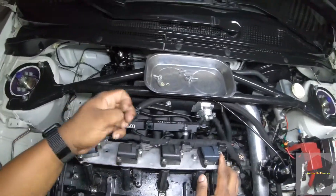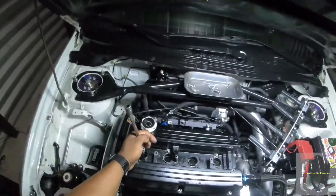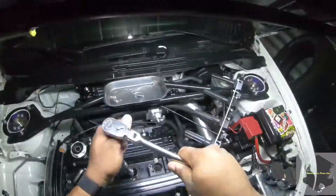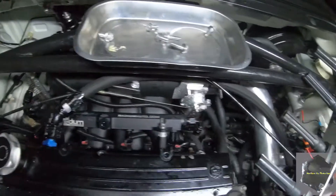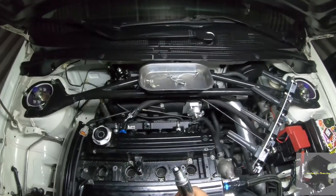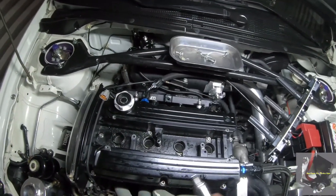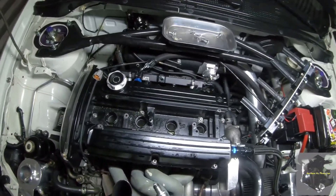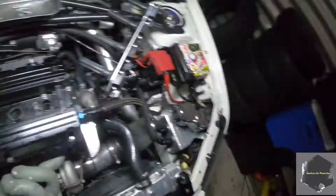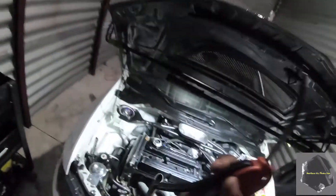You can see coolant all under here. It burst at high RPMs. When I pulled the first spark plug out, I could see it was wet — I can't tell if that was because I just took it out or if that cylinder is filled with coolant. I'm going to spray these guys out real quick, because if it had that much coolant going down in there I wouldn't have made it back that day. I have a compressor, so let's blow them out.